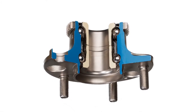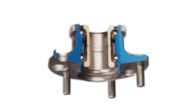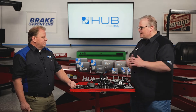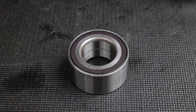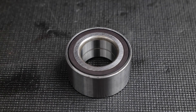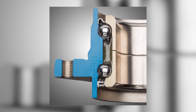Did a job recently, and the torque specification on this, I think it was 225 foot-pounds. Why is it so high compared to maybe a hub unit that may be 110? Because these are the Gen 1 bearings where you're going to have a wheel flange pressed in and pressed into a knuckle. Getting them all sandwiched and oriented properly is critical, and some of that is done through the torquing of the axle nut.